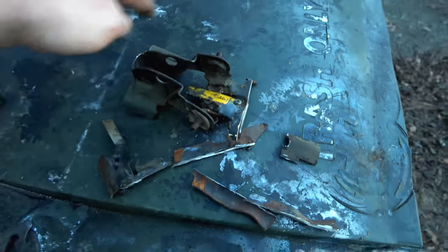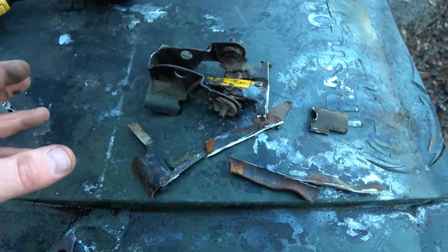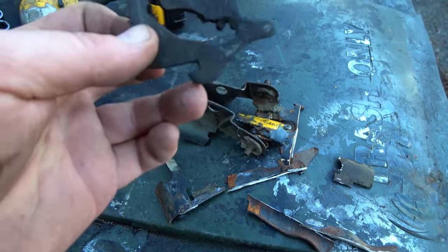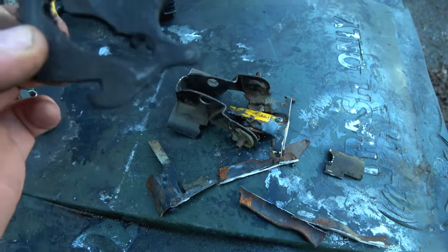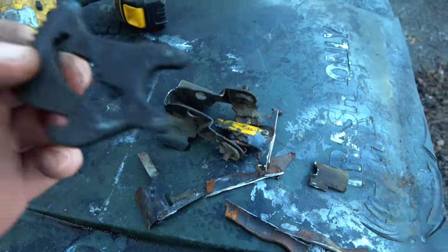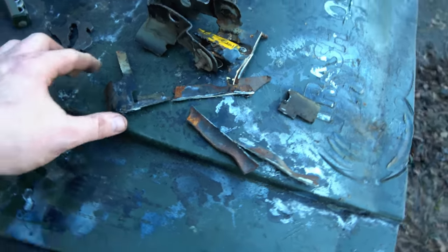Now, the area around here, when I started scratching off some of the paint, there was a lot of brazing work done in there. So somebody has also, at some point, cut apart this tunnel. In addition, the little pawl gear that's here didn't have a long enough peg, and it did not engage properly with the tunnel. Now, somebody may have changed this out at some point. Maybe they broke the e-brake handle, put it in, it wasn't working right, then they started doinking with it, and I don't know. Whatever happened here, complete catastrophe.